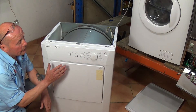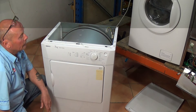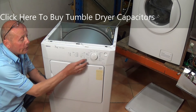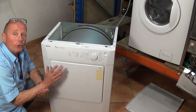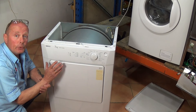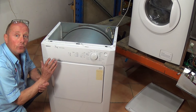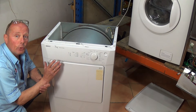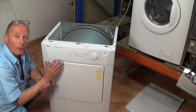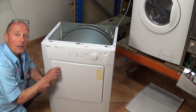With the capacitor replaced, I'm leaving the lid off so you can actually see the drum turning when we press start. The drum starts straight away. Thank you very much for watching this video. If you want to fully service your Beko tumble dryer there is another video in the link above. If you need parts, please make sure you check the µF rating of the capacitor — it is very important to replace it with the correct size. There is a link below to all tumble dryer capacitors, and if you have any questions please contact us at the website.